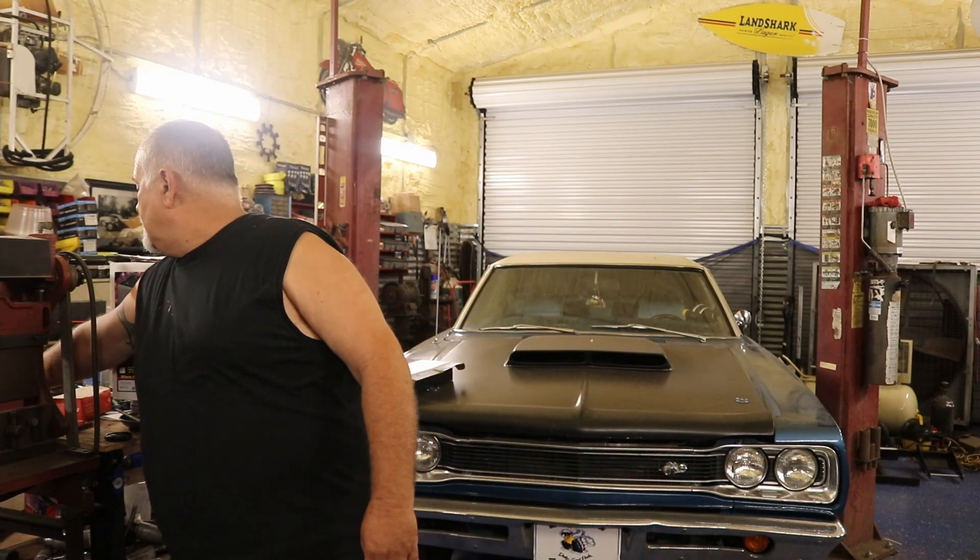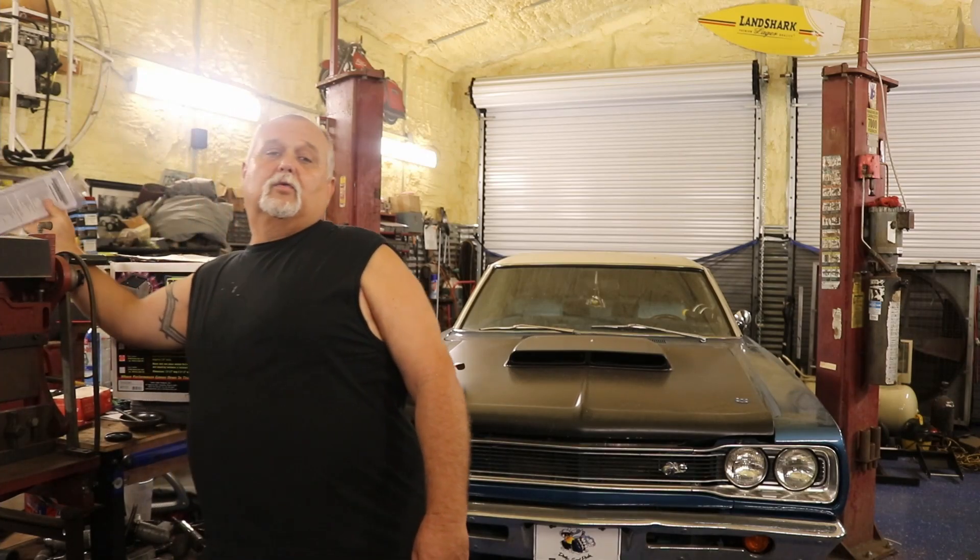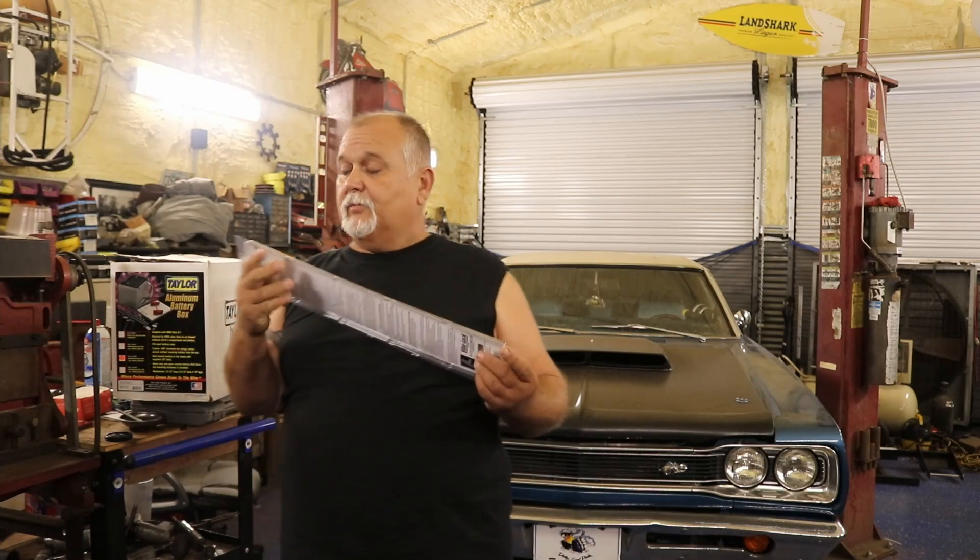So this video we're going to tear this thing back apart. As far as the battery, some wiring, I've got to take the exhaust off. Also I've got those new header gaskets — this does have a leak on one side so I've got new header gaskets to put on, which means the header's got to come off to get the starter off. Opportunity knocks — we're going to strike at it.